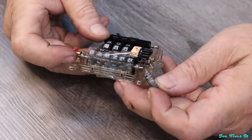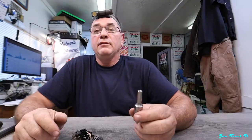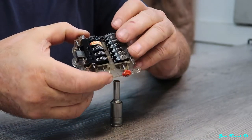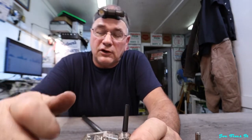The next trick is to force the gear back over the shaft without breaking the fragile plastic housing. First put the gear back in its normal position — pull the shaft out just a little bit without dropping the little plastic gears off — and push the shaft up against it to hold it in position. Then you'll need a very small socket; in this case I'm using a 6mm socket so you don't pound directly on the housing. Make sure everything is lined up and very carefully press it on. You want it to turn freely — if it's hard to turn by hand you've driven it in too tight and you'll need to loosen it with a small punch from the other end. Sometimes I'll put it in a vise to prevent mushrooming the end of the shaft.